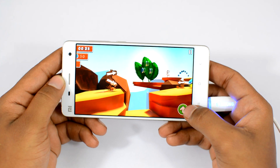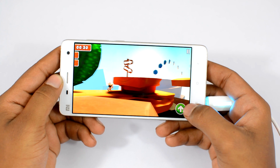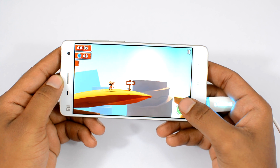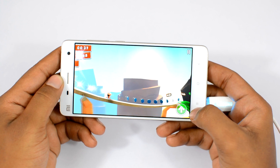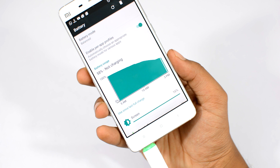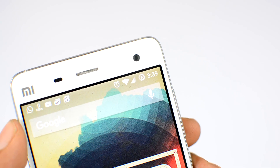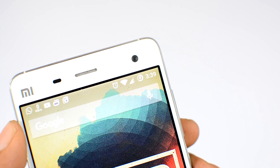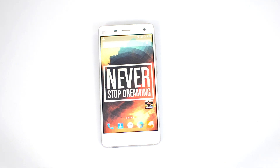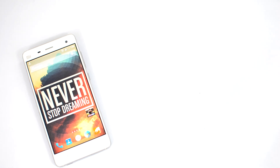I also noticed that doing heavy multitasking — things like playing games or surfing the internet while the device is charging — increases the device temperature, which may reduce battery life and also increases charging time by up to 200%. On some smartphones, especially the bigger ones, the battery percentage meter refused to increase or increased only very slightly while using the device during charging. Although keeping your phone off is not the ideal way to charge your device, when it comes to getting the most charge in the least amount of time, this might be helpful.